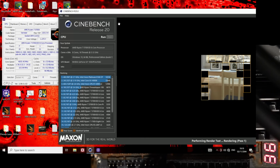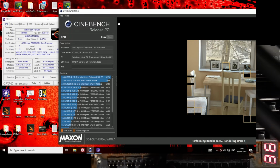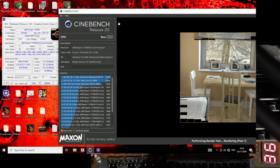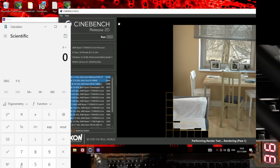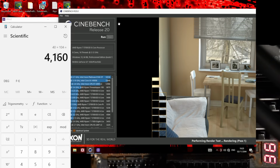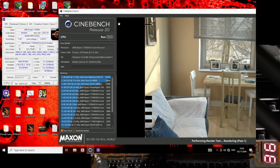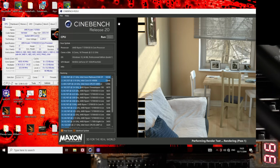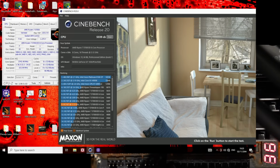Yeah, and it runs at like 4.05. This is my frustration, right? If I bend over backwards, I can get the CPU to run 4.2, and you would think, previously the CPU ran at 4-ish gigahertz, so if we multiply 40, which is the core ratio, times 104 BCLK, we should get 4.16 gigahertz, right? And then when you look at what we actually see in CPU-Z, it's like, nope, you get 4.05, because the core ratio has reduced itself from 40 to 39. The boost algorithm just actively works against you. Yay. This isn't new, but that basically did nothing.